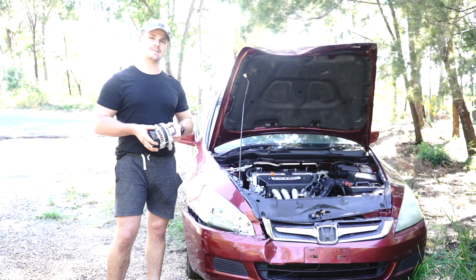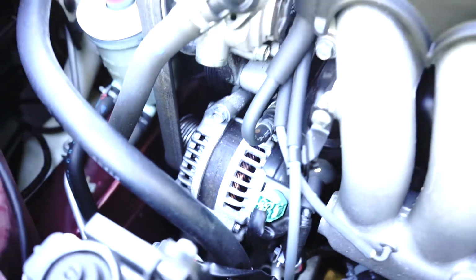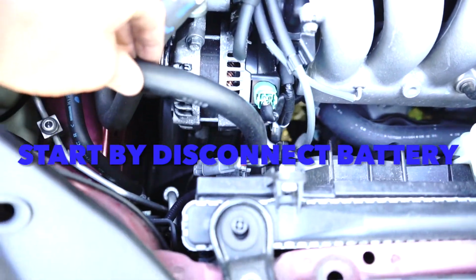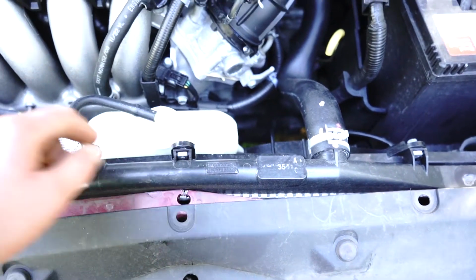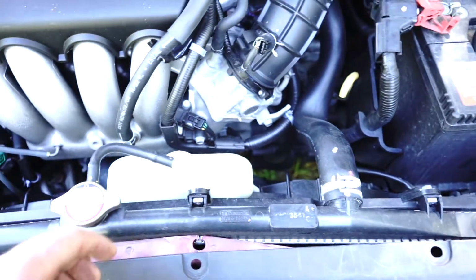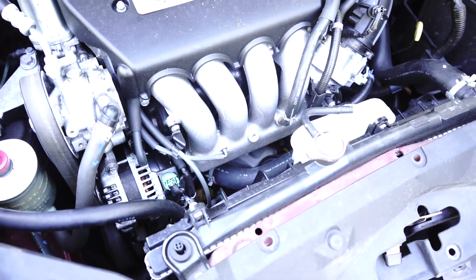All right, guys, let's get into the fit. So there's your alternator. Now, with one bolt here, 2 on the bottom, but you can obviously see here that it's quite tight, and the best way to get to the bottom bolts is probably going to be undoing 1, 2, 3 of these 10mm bolts, pulling this plug on the fan, thinking about removing this radiator pipe, just popping it off, moving it out of the way, and pulling out these thermofans just to get a little bit more room. I'll try that out now.